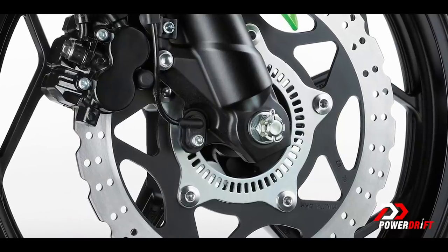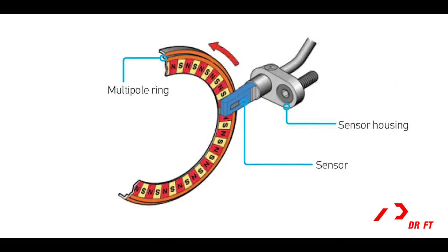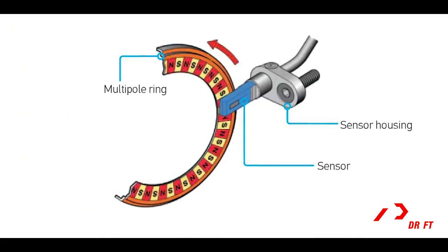The slotted wheel is a small metal ring on your hub, with a magnet placed very close to it. The magnet reads the arrival and passing of the spokes and slots — when a spoke comes close, you get a spike in magnetic force; when a gap comes close, you get a depression. The difference in amplitude is used to calculate how fast the wheel is rotating. This is why a drastic change in tyre size can upset the calibration of ABS and traction control systems, since both rely on that slotted ring and the known tyre circumference.